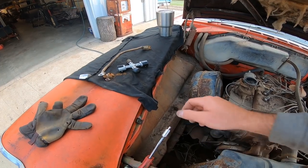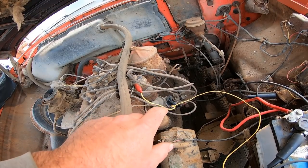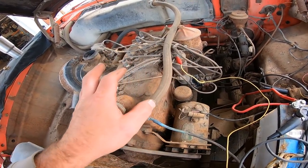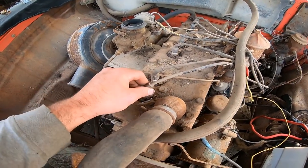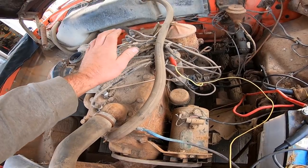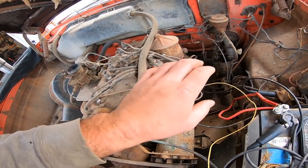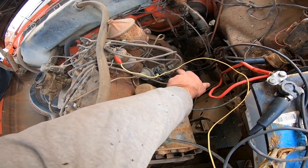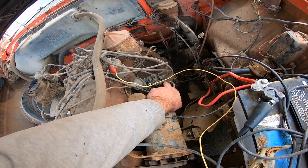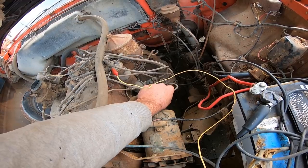Put our rotor back on. There's our distributor cap. Let's blow that out and scratch the corrosion off those contact points with a screwdriver. Look at this fender cover we put on there to protect that nice paint job - we're professional around here, it's an old t-shirt. Tech tip of the day: clean up the contacts on our distributor cap. Next would be the plugs and plug wires, but I'm sure those are completely fine. Rubber is nice and flexible. Number one wire has got a red boot on it so you know where that goes - these are the good wires.